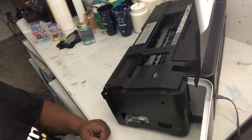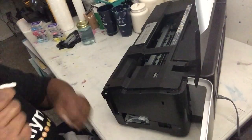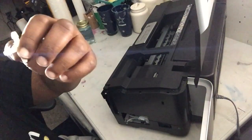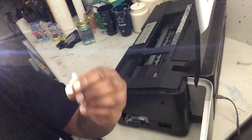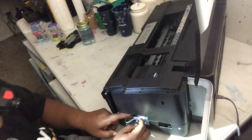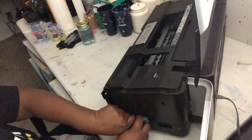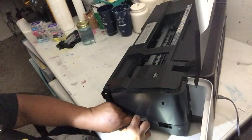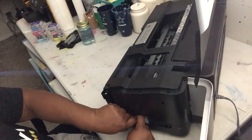If you got little fat fingers like I do, it might be difficult with these little tubes. After that, you want to pull them off. Since I got two lines, I'm gonna use this little T-adapter for the two lines — I'm gonna put a line on each side of it, and then the regular line connects out. You wanna take these and just yank them off. It might take a little force — take your time — but they'll slide off.